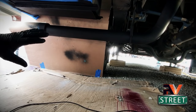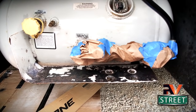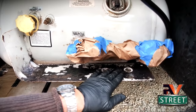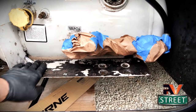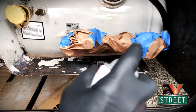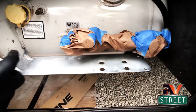Here we are at the propane tank area. You can see how the Permatex has turned it all black - that's what you want. We've got this all clean with Permatex. I give it a quick test shot and we're going to put on our first light coat. This is a light gray - the Rust-Oleum. Nothing heavy here. There's our first coat of gray.